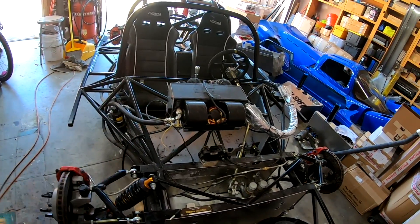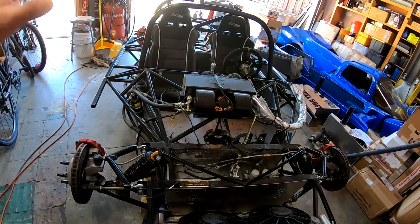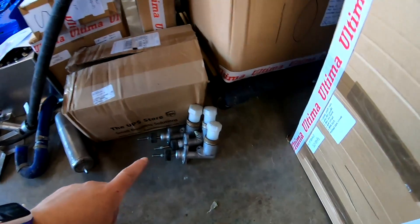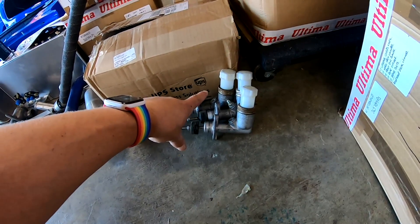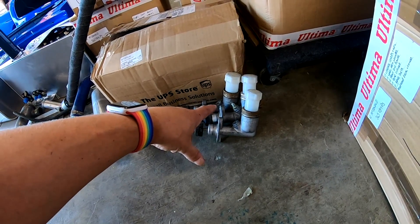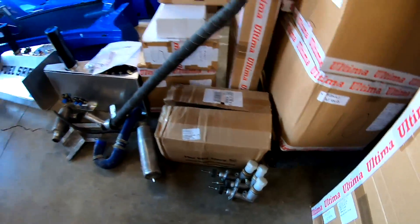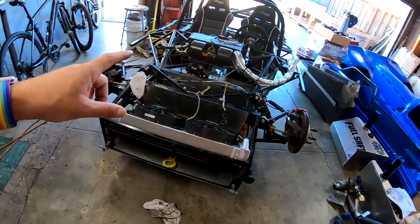I think the questionable one with water and corrosion just needs to be brushed and cleaned up, but everything else up here was looking good. I'm sort of happy with that even though we're removing all those boots. I've got the master cylinders out — the sizes are three-quarter inch for the front, five-eighths inch for the back, and the clutch cylinder is 0.7 inch, which is a weird size but just under three-quarter inch. Pro mechanic tip: make sure those are empty before you undo all your lines because I thought they were and they were not — a little bit of a mess.